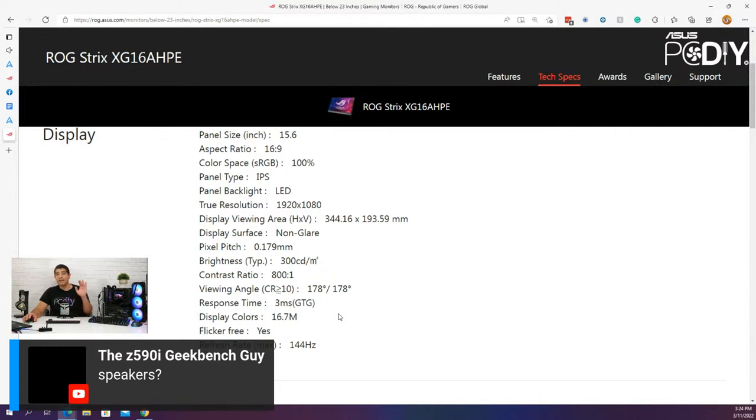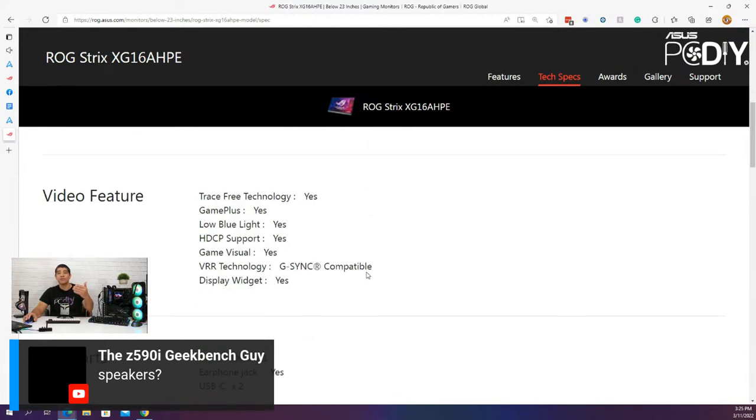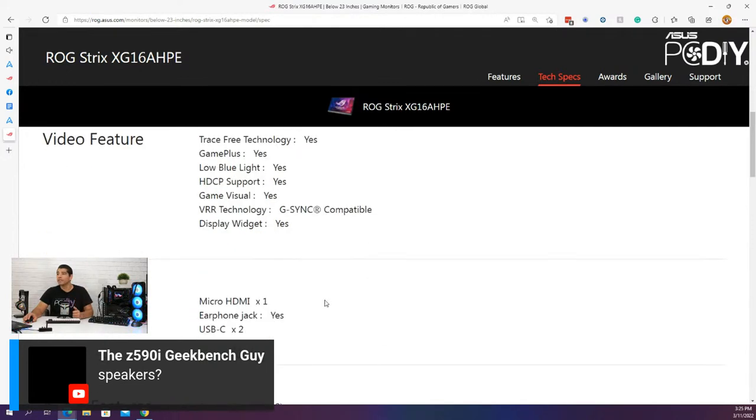You're very rarely going to find laptop displays, whether they're portable or built into a panel, that will have less than that. Very commonly, the response time on a lot of traditional LCDs can be 15, 20 milliseconds or even higher. So this is actually quite good when we talk about the performance for a portable display. It is really comparable to what you would see within a good quality display. And while it does also have those speakers, it also has that earphone jack, and that earphone jack would provide a benefit if you connect an analog set of headphones, because it also has that ESS Saber DAC and amp in there, okay?